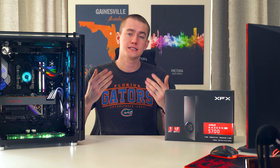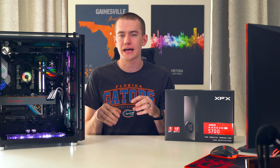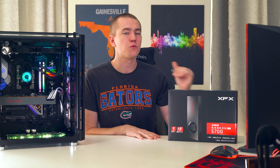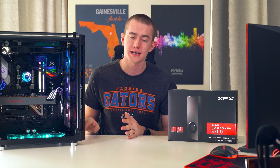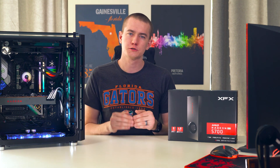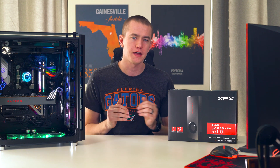So I decided to install the even more power table, which allowed us to get up to 90% power limit where you can increase the voltage. However, one of the notes on Igor's lab guide is that the even more power registry edit is experimental at this point. What I found was that it gave us no additional performance — none of the voltage modifications I was making allowed me to get anywhere past 1,900 megahertz. It could be that it's still experimental and there still needs to be more modifications on the voltage side. Because in Igor's testing, he found the 5700 XT could hit 2.2 gigahertz and was totally fine — this should more than likely be able to do that, but it just didn't have the capacity.